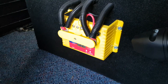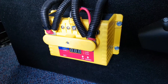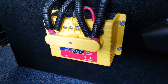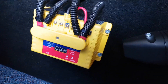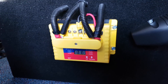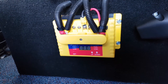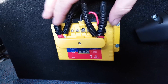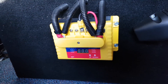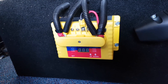Down the front here we have our VSR — this is a programmable VSR. You can pick one of these up from Super Cheap Auto for about $230, less if you've got trade accounts. I think I picked this one up for about $200. This is a programmable VSR which makes it a lot more flexible than traditional VSRs, which are a voltage sensing relay designed to switch a bridge between both our starting battery and our auxiliary battery, connecting them together, and then when the voltage in the auxiliary battery drops it disconnects the main battery from it to insulate the main battery from any drain.